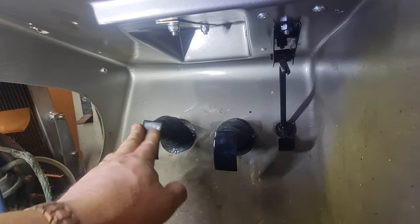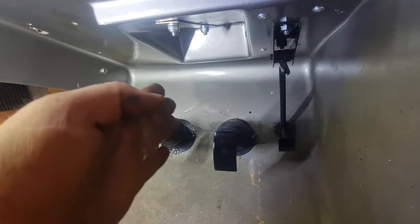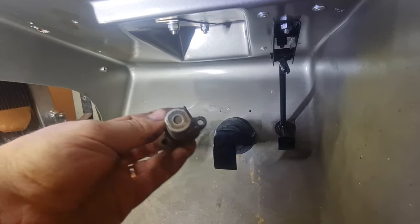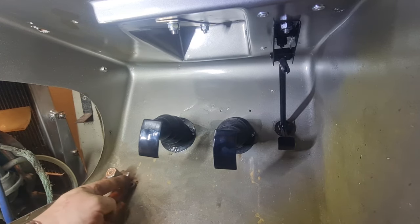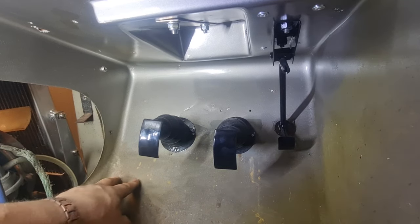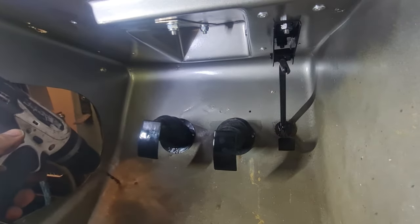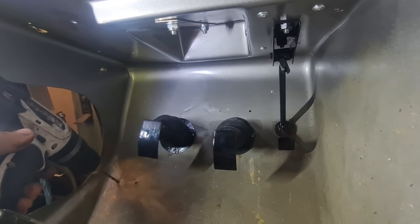There are our pedals on - they are a bit wonky, they're going to want a little bit of bending. While we're in the footwell area we're going to be fitting the new main beam switch which goes just there where those two holes used to be, so I need to drill those back out again. Where I've done some fibreglass work I went over the top of them to reinforce it, so now we're putting it back we'll just have to re-drill. This switch is held in with two little Phillips screws and some small nyloc nuts.